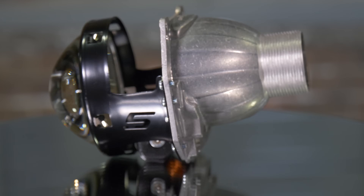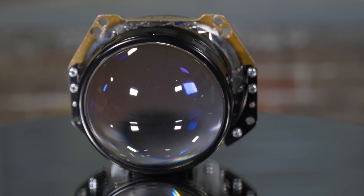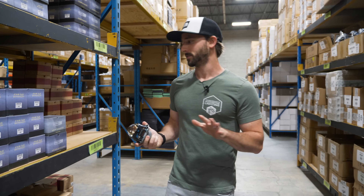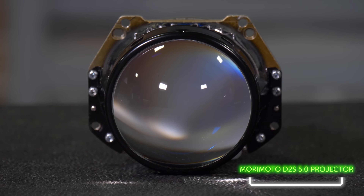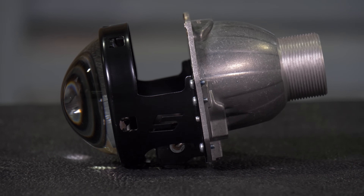Now it's time for the fun part — let's do a little shopping. We're going to start with the bi-xenon projectors because that is the heart of your retrofit. There are tons of different options at TRS and on the market: OEM, aftermarket, 2.5-inch, 3-inch, left-hand drive, right-hand drive. For all intents and purposes, we're going to use the Morimoto Mini D2S 5.0 projector — basically industry standard for ease of installation and the actual amount of light output and quality it produces.